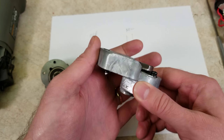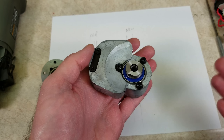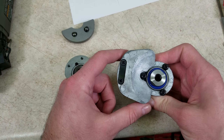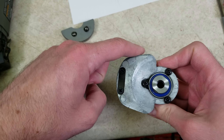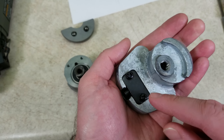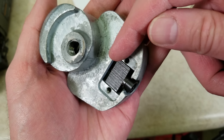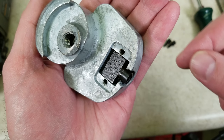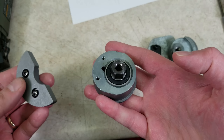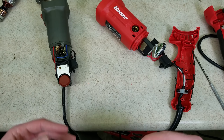The longer throw is a benefit because with every rotation, that pad is covering more surface area and doing more work correcting the paint. The downside of that bigger throw is you need a much bigger counterweight to keep everything balanced. They cast this big counterweight into the assembly, and there's also a screw here with an adjustable block underneath that you can move in and out to fine-tune the balancing. On the old one with the much shorter throw, the entire assembly is smaller and the counterweight is just a little cast piece that screws on.